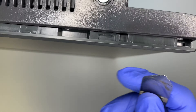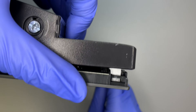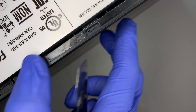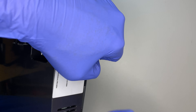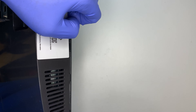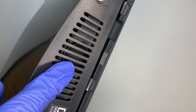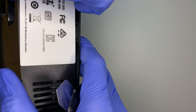At this point, you want to get a metal prying tool, stick it in between where the crack line is, and slowly push the screen out a little bit away from the plastic. Take your time, no rush. You do not want to stick the prying tool too deep — if you stick it too deep you might damage the internal parts. The speaker is actually right here at the bottom, so make sure you're not sticking too deep to damage the speaker. The Wi-Fi is around this corner as well.